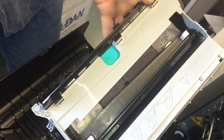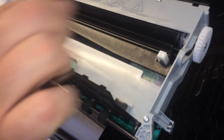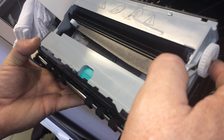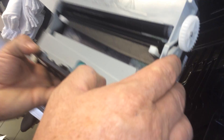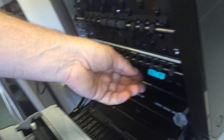If you see a lot of buildup on the tray or in the matting underneath it, just take it to a sink and rinse the waste ink tray out as best you can, then wipe the roller down. After rinsing, let it sit upside down and drip dry for five or ten minutes. There's nothing on here that's going to be damaged by rinsing it off.